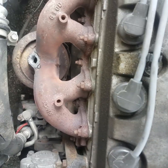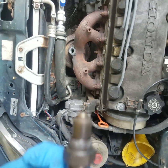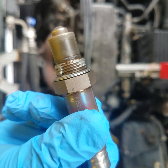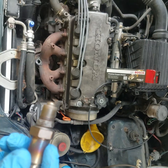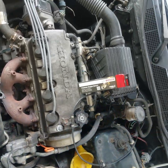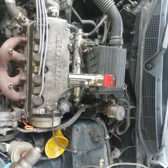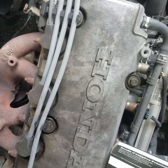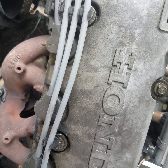The new one comes with a little bit of anti-seize from the factory, but that's not a lot at all. Most people will say that's all you need, but using more anti-seize on an exhaust part can't hurt it — it's not gonna hurt at all. It's not gonna come loose. It'll just keep it from being a pain one day when you go to change it and need to get it out.